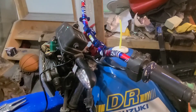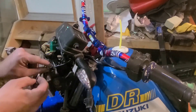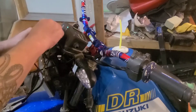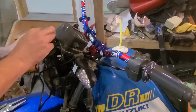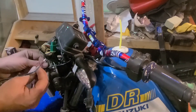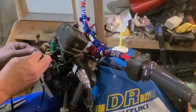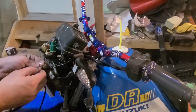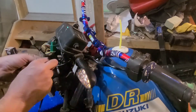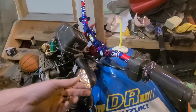That's looking beautiful. Pulling the old one off and trying to remember which wires — it was the black and orange ones. Tried them and nothing. Let me try reversing those. I said black and orange... apparently not in that order because it's not working. Okay, switching them around — there we go, those are nice and bright. Nothing wrong with that at all.